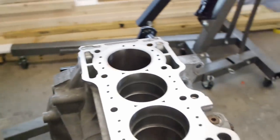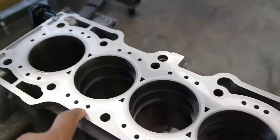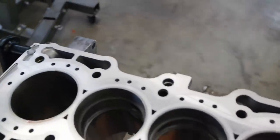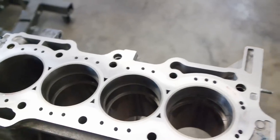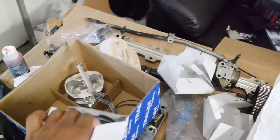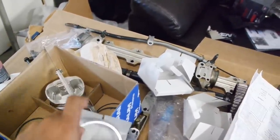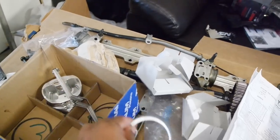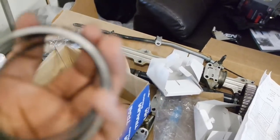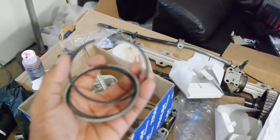And then you have what they call the top ring and the second ring. If you look very closely, you'll see that I already have done cylinder one, two, and three. They're done — they're gapped. Basically what you have to do is, when you open your box it should look similar to this. Technically you'll have five rings in there, but three of them make one section of the oil ring on the piston.